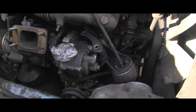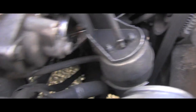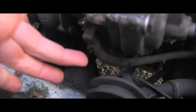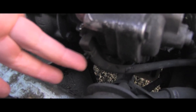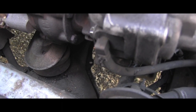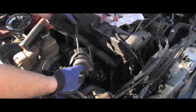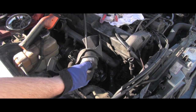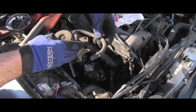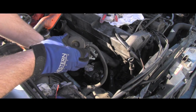The sun is making it difficult to film, but you can see the actuator sitting right here, and it's attached with that hose to that pressure outlet right here. I'll take pliers and just slip this clamp and remove the hose from this attachment point. And now here is the whole wastegate actuator — you can hopefully see it nicely here. That's the hose, which is bringing the pressure to it, and I'm ready to test it.